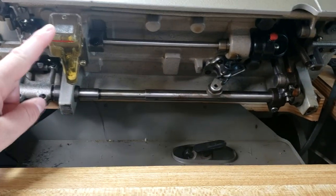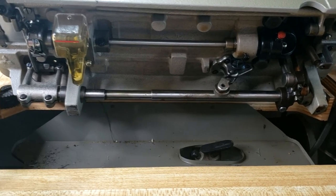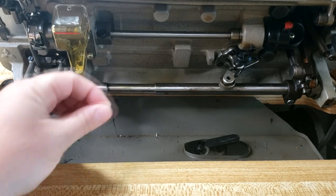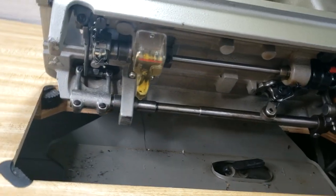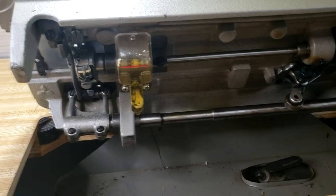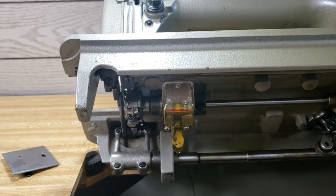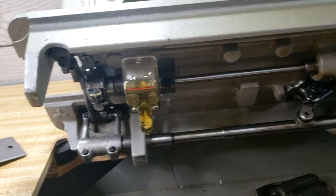Here is the bottom. There's a reservoir here with a fill line, so I just put the oil in there. I've never seen an industrial like this — usually there's a pan at the bottom with wicking threads that wick up the oil. This is the first time I've seen this setup, which is why I'm trying to find more information. There is the bobbin, and this one actually has a larger bobbin than a normal machine, which is great because you don't have to wind as often — especially with thicker thread, which you'd go through a lot faster.